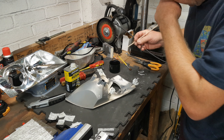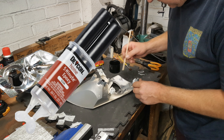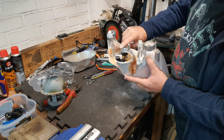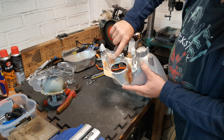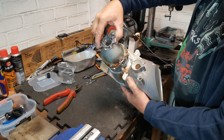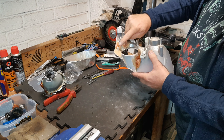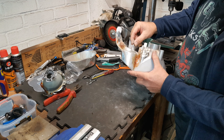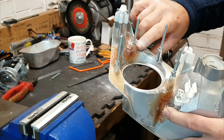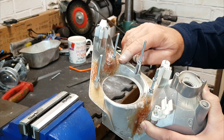Follow the instructions on whatever fiberglass kit you've got, or maybe you prefer to use body filler or some other means, or you could use epoxy. Once you've stuck your bosses back on and you've added some material to strengthen them up, finish the material off to your own satisfaction. Try not to add too much material on this side closest to the projector lens, because some of the bosses are closer to the lens than others and you don't want to create any interference. Bear in mind that ultimate neatness really isn't the goal here — strength of the bosses is the goal. I must confess I'm not best practiced at using separate glass mat and resin; I would much prefer to have used a ready-mix product such as David's P40. I'll link you to some suitable products in the description.